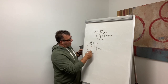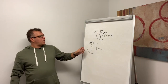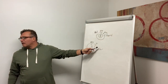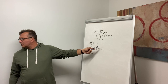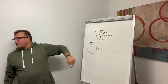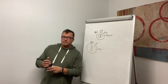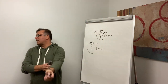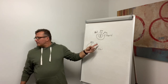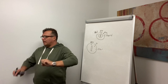When you're turning your lights on, first of all, make sure you click it twice, okay? Because this is parking lights. We are not checking parking lights. All the way to the right, click, click. Then it's supposed to turn on your headlights. But if you put it in accessory, only two lights are gonna work: parking lights and four-way flashers.